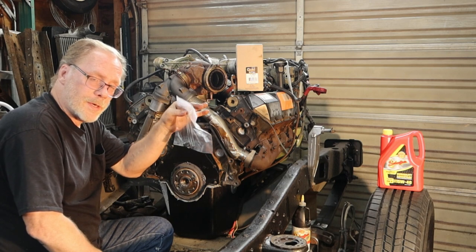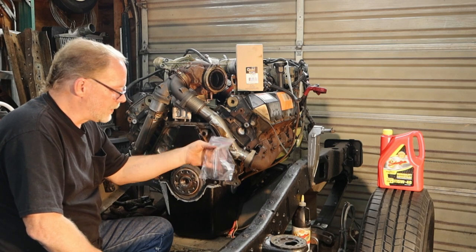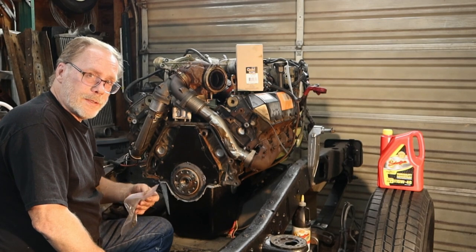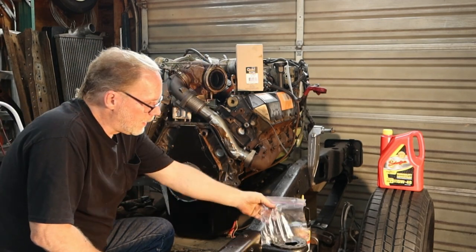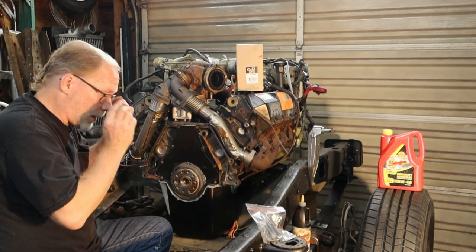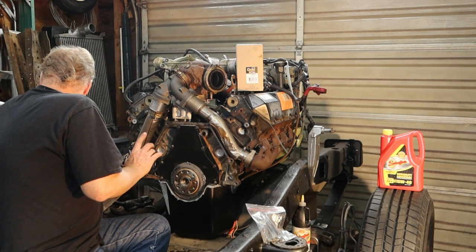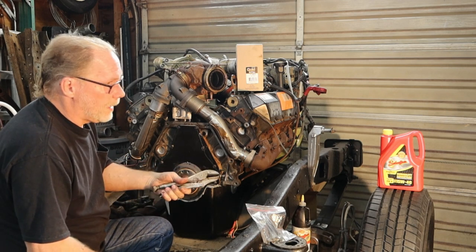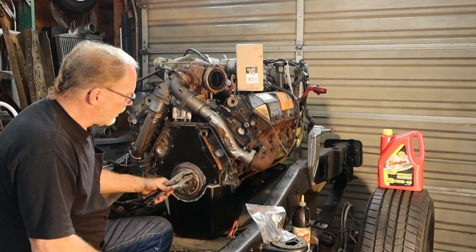What were they for? You never know if you get interrupted in between doing a big job, or if this is something that you're working on the weekends and later on it's first going to be driven. Know your fasteners. Put them in a bag, put them in a can, mark what they are and how many were there. So get those bolts cleaned up. And hopefully we can get a picture of that.